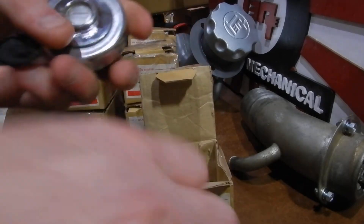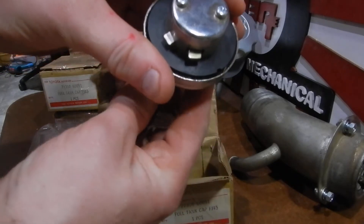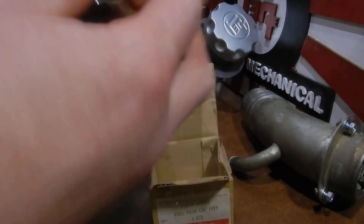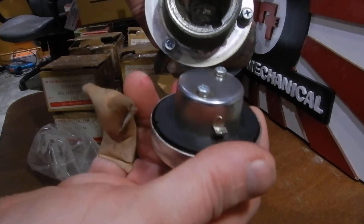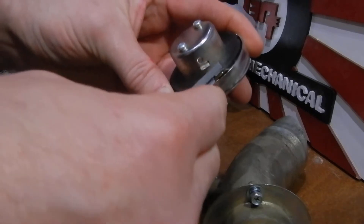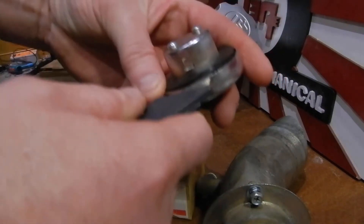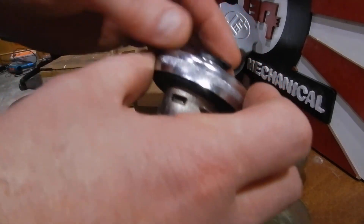The cap is a good design — it's got a nice sturdy rubber locking cap on it. The keys go in and they engage the locking mechanism. It's unlocked here. What I have is a smaller late-model fuel filler neck which is proper for this cap. It goes on and engages just fine. The EPDM seal is thick — about 3/16ths, maybe three to four millimeters — thicker than a non-locking cap.